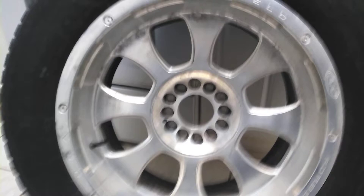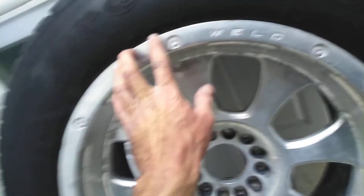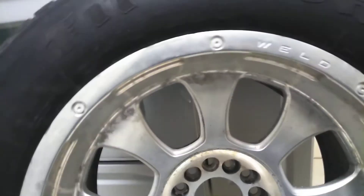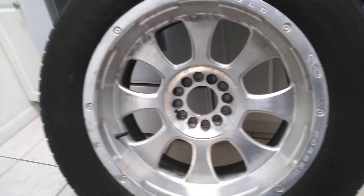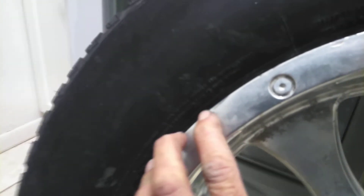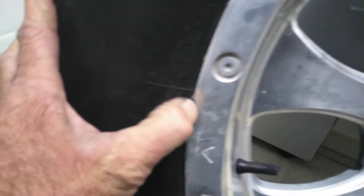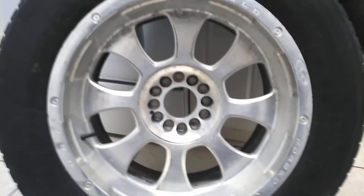Now I'll tell you how I do this. For some of these rough spots, I use a harder grade of sandpaper to even them out, flatten them out, and then I step my way down. Usually I start with a 600, do an 800, do a 1,000, and then do a 1,200. But sometimes on rough spots like here, I'll start off with a thicker grit, smooth that out, and then come back and sand with the lower grades. All this I'll hit and flatten first, then step it down from 600 to 1,200 to get it smooth. And then my last pass, I'll do one more pass from 600 to 1,200 to get them all baby smooth — and this one as well.